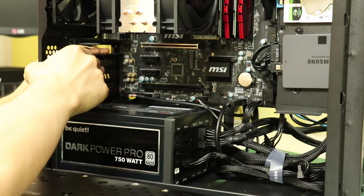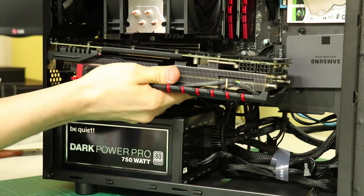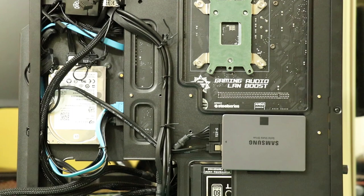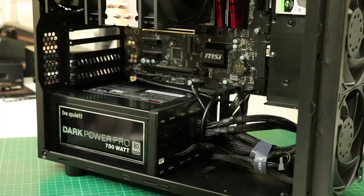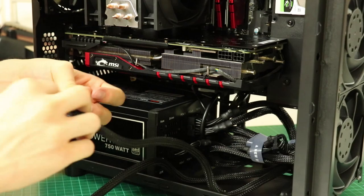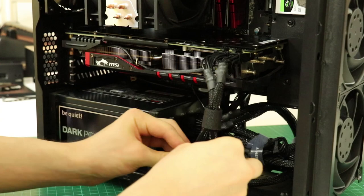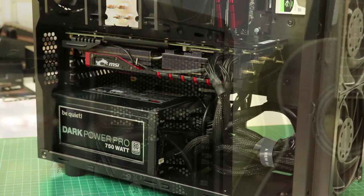So we're heading towards the end of the build. The last major component to install is the GPU. After punching out the PCI Express covers, it didn't take too long to work out that the SSD cannot be located in its current position, so it needed to be relocated around the back of the motherboard tray. It would have been nice to see some screw holes here specific to mounting the drive, but double-sided tape will do. Now we can collision-free slot the GPU into position and secure it with the screws provided. You may be able to make out the protective sheet preventing scratches to the case that could be caused by the GPU. Once secured, it's a simple case of connecting the power in a way that doesn't look terrible.